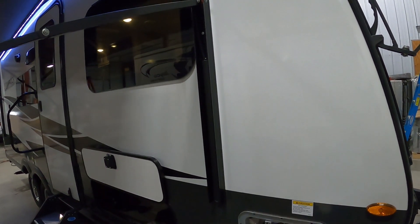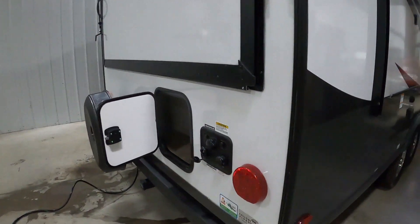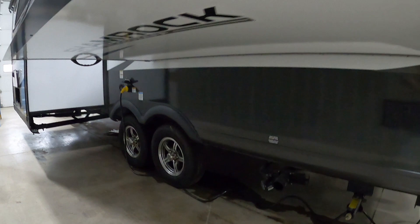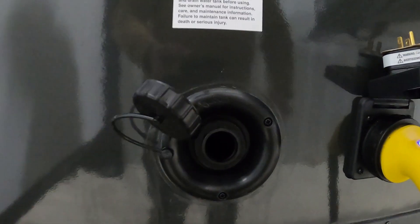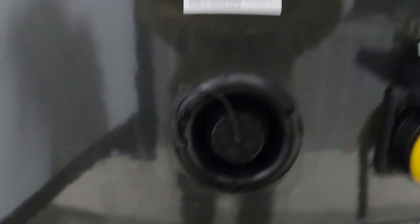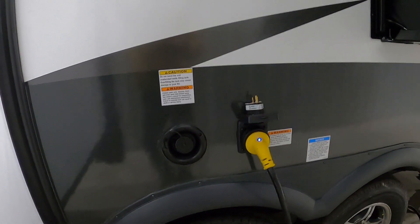Now let's say we're not going to a campsite — we're going to go dry camping. In that case, we're going to fill up our fresh water tank, which is over here on the off-campsite side next to your power. No need for a water pressure regulator here — simply gravity-fill it with a hose. Two ways to tell it's full: one, there's an overflow valve right here; or two, on the inside where you check your black and gray tank levels, there's also a fresh water button. Once it's full, put that cap back on. To use that water, turn on your water pump. Don't turn on your water pump when hooked up to city water — that's already pressurized.